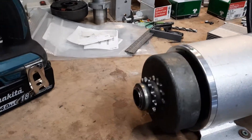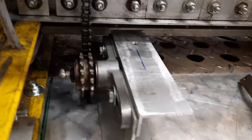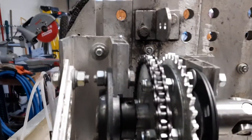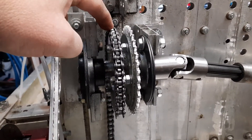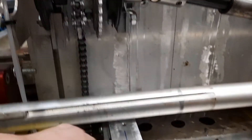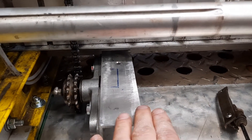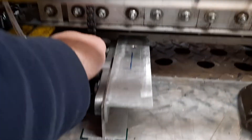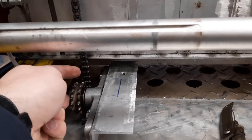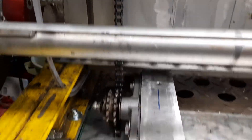So as test number one it's not bad. I plan to put it in here where I have this tensioner, and there's my second sprocket — that'll be my gas motor sprocket, that'll be my electric motor sprocket. Down here that platform is where the electric motor is going to sit, and the chain — this isn't bolted down right now so it's going to move all over the place — but basically the chain is going to come up here and over the side of the electric motor.